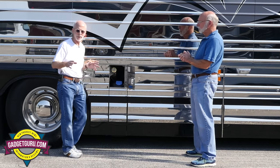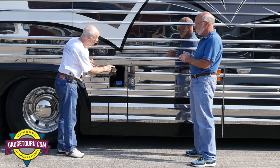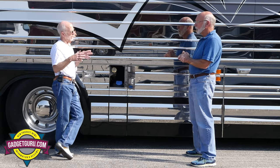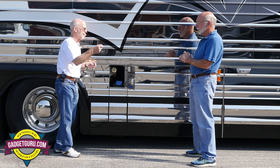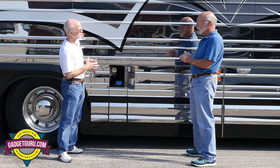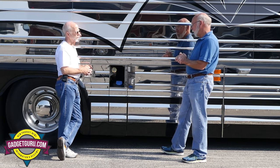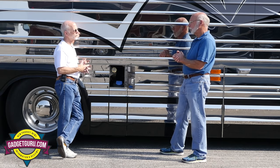There's a point of confusion here — a lot of this is not necessarily Marathon, it's Prevost. On this 2014, on both sides of the coach we have a diesel filler, and below here is the DEF tank. Now if I'm going into a fuel pump, it's typically going to be on the driver's side for diesel. The diesel exhaust fluid tank holds 16 gallons in this tank, and approximately 200 gallons of diesel. At commercial truck stops, the DEF fill is always on the other side — and because of our height, we're going to be using a lot of commercial truck stops.